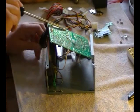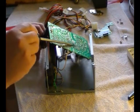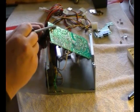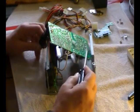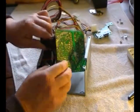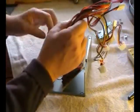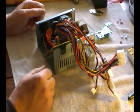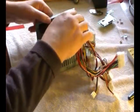Now if you want, you can come up here and make sure all these capacitors are dead. In fact, it wouldn't hurt to do it anyway. I mean, there's nothing there. Okay, we just double check down here. Yep, that's fine. So now the printed circuit board is safe to touch, but I would recommend treating the printed circuit board as if there was still something in there. Okay, now then, excuse me, that's all the safety bits.